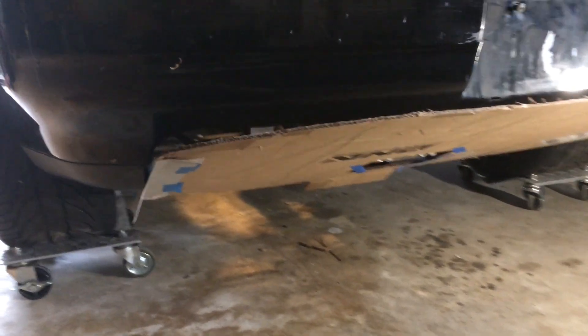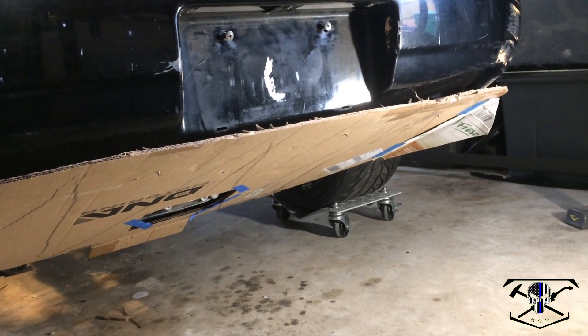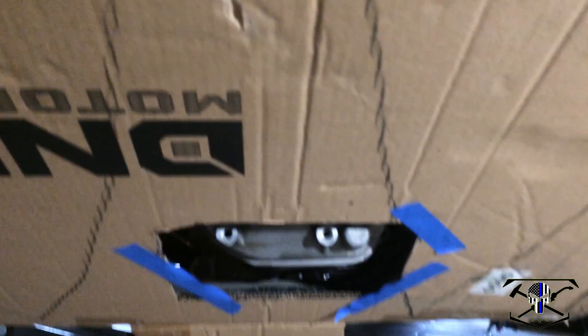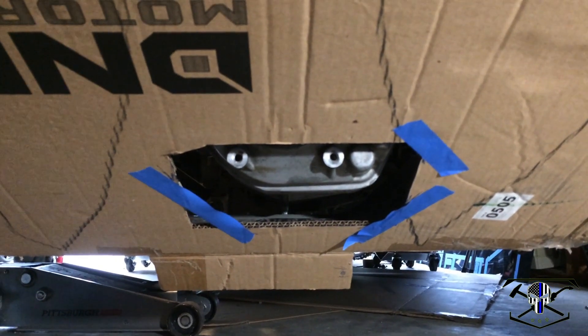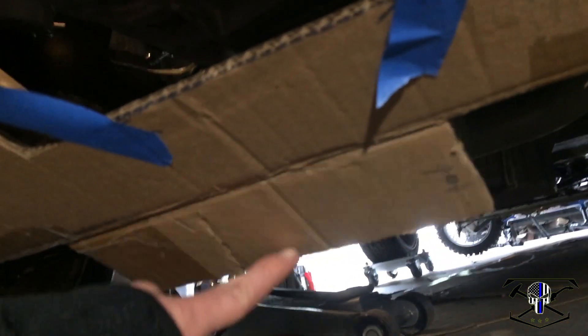So I have a side vent — I call that a louver — on either side. We're going to add more later because we still have to work on getting the reverse light mounted about there. We can see I had to make an access cut for where the transaxle comes through, which is no big deal because I believe I'm going to have a center section here that holds that reverse light. This is one that's going to fall down on me — one tab to mount to the crossmember, as well as one up here and up here as well, so there are going to be four mounts to the crossmember.